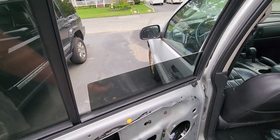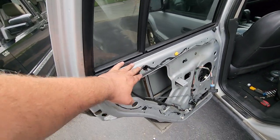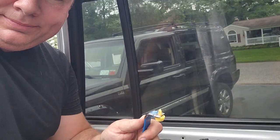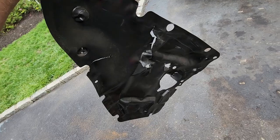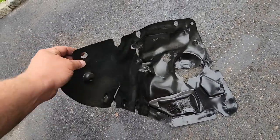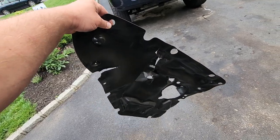Now it would be a great time to lube the track with some silicone spray. You could also dump in some Vaseline, WD-40, fluid film — anything in there to prevent the rot. Soak this thing with anything oil-based, because you want to keep out the water and prevent the rust. Before you go ahead and put the door panel back on, make sure all the clips are on your door panel. If they're cracked you can buy new ones — I'll leave a link in the description. If you have to wait for the regulator to come in the mail, might as well wait for these too. If you wish to reuse the moisture barrier, be careful — it is brittle. Make sure you put it on before the speaker; it's got a little speaker hole. A shower curtain would work better — watch my ZJ video where I put a shower curtain in there. And that's it — button that sucker up, you're good to go.